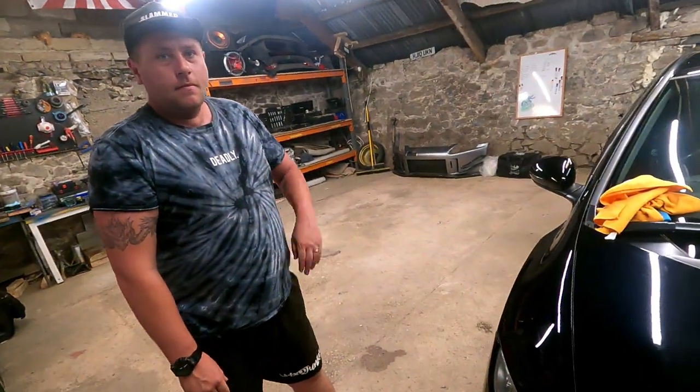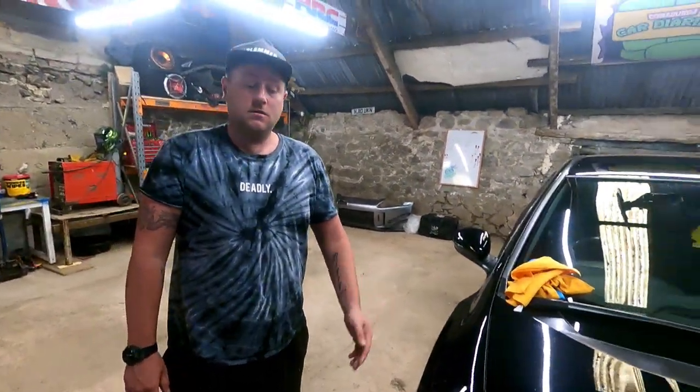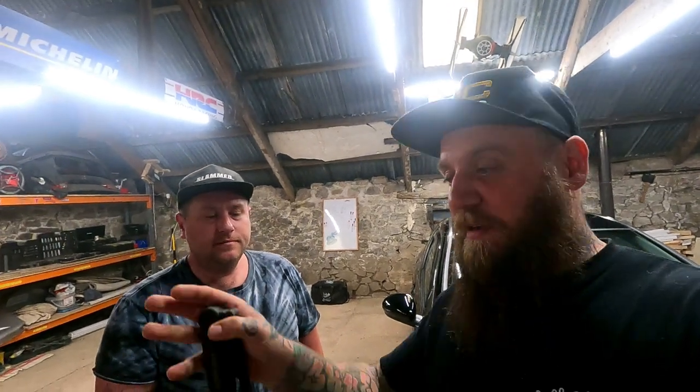Hopefully, mate. Is there anything to watch for on the clay bar? Not really, just make sure you lubricate the surface with the spray. You can feel it when you're going over it. Yeah, you're rubbing it, there's loads of drag on it, and it just gets less draggy every time you do it. And then you run your hand over it, and you can feel straight away. So all the crud comes off. You can clearly feel where you've been and where you haven't been. Totally. But just make sure you're generous with the spray.